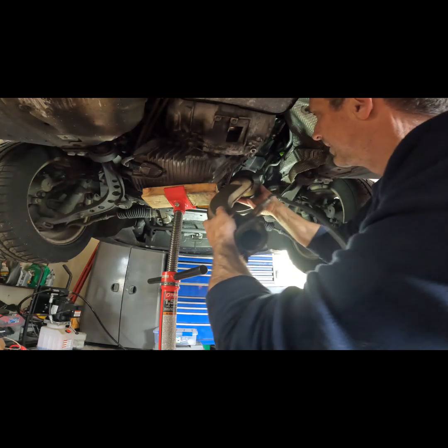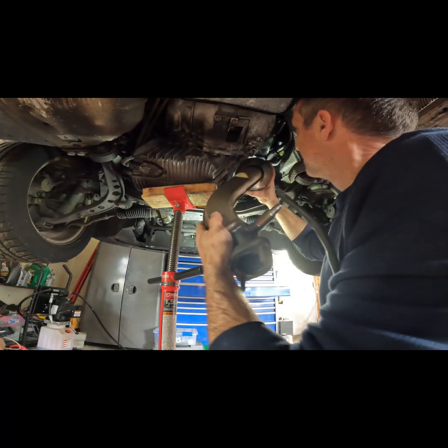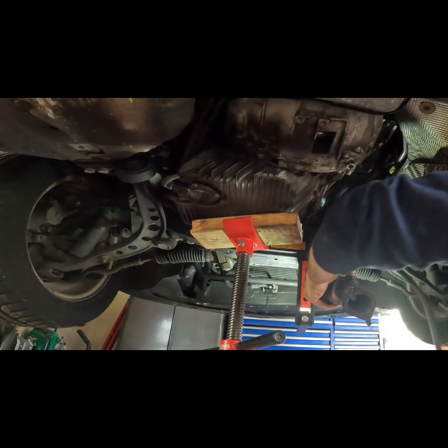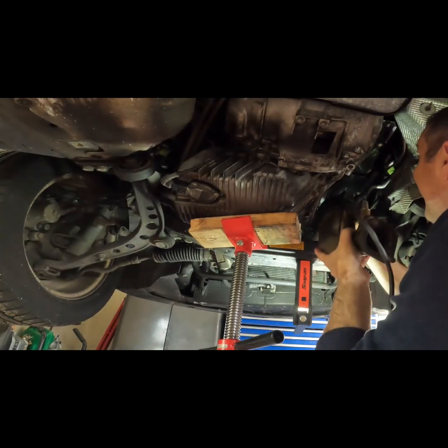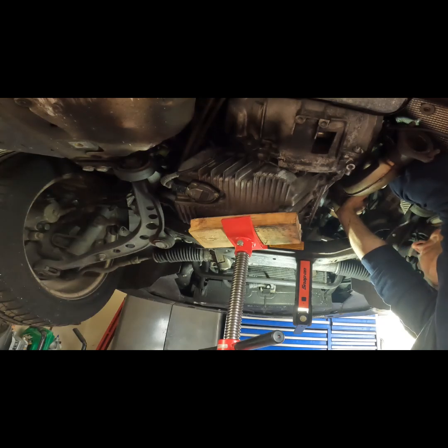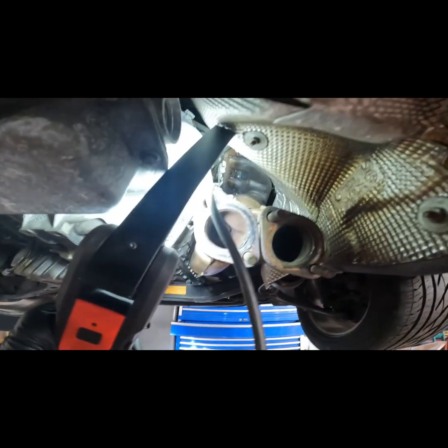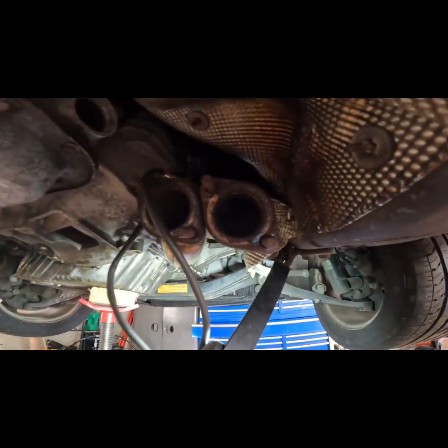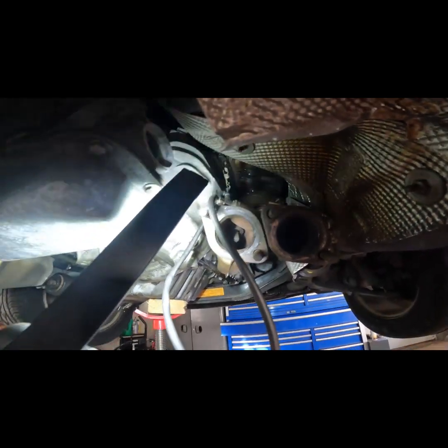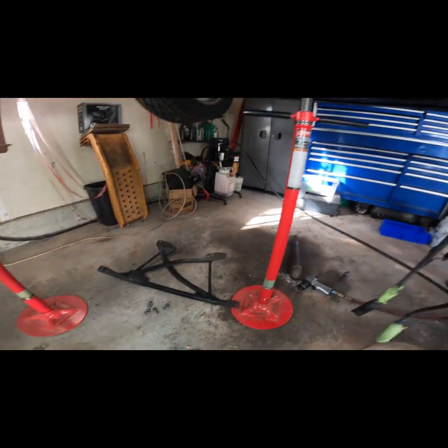Let's sneak that in. Now that I have my bracket out — there we go — grab a nut. Both cats are in place from under the car. I did take the control arm bolts off and pulled that down, which gave me a little bit of extra space to sneak in the back cat. I'm going to leave the brace off so I can feed everything up after. So it's time to go back to the top.